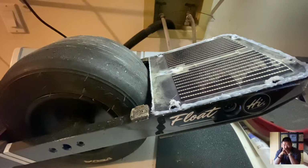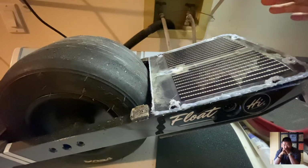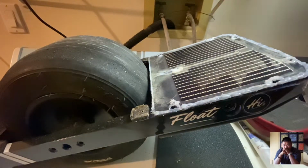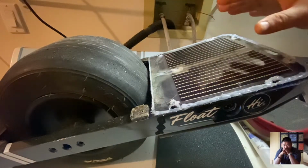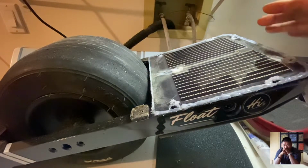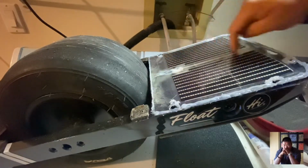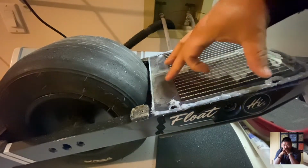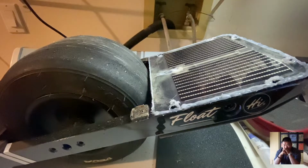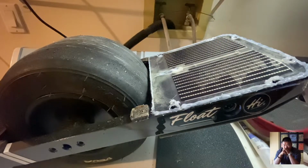I know it's relatively straightforward. I'm not going to go over how to do the sensor transplant because other people have made V1 sensor swap videos and it's kind of beating a dead horse. Basically, the quick version is you throw your whole stock sensor into an oven, bake it for a couple minutes at like 275 or something, and peel it off. I peeled it off in one piece. That's this plastic protective sheet here, and then the actual sensor sheet here. I started at the rear and pried it up. I wouldn't go too extreme with the angle, no more than say 45 degrees, and it'll work fine.